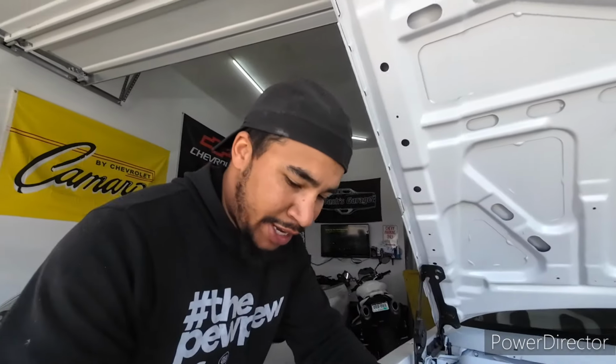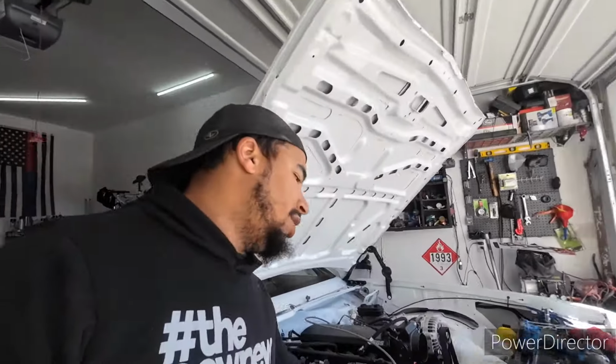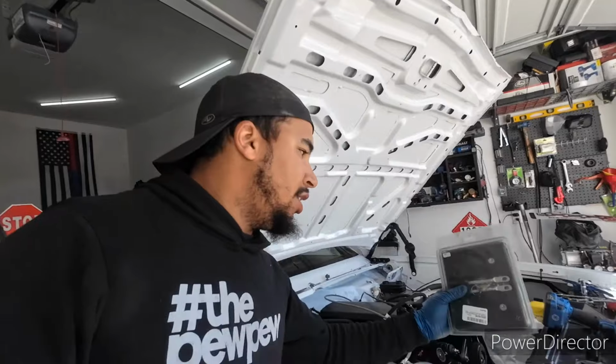Just a quick recap. I stepped it down to the 3/16 line instead of the quarter inch line, and used different fittings, brass fittings instead of stainless steel fittings. And I think we're onto something. So I'm going to keep an eye on it and make sure nothing else is leaking, then either today or tomorrow, knock out bleeding the brakes.